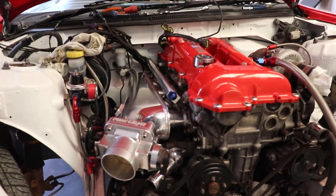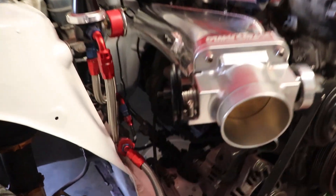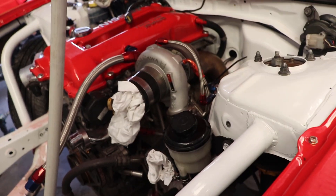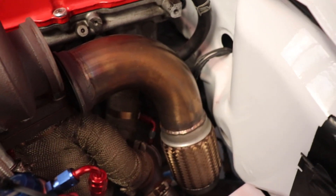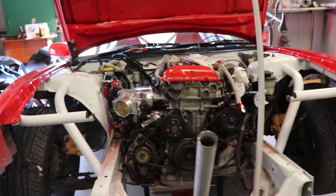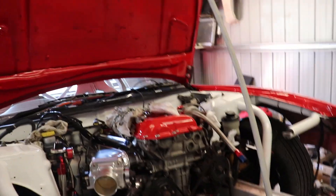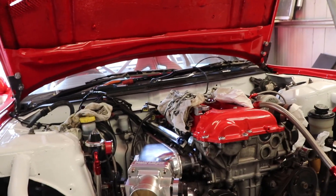We're getting there — fuel lines are off, wiring's been pulled out from under there. I've just got the engine mount, there's a slave cylinder on the gearbox, the gearbox cross member, the oil lines for the turbos, water lines I'm just going to be pulling out with the motor. Dumps are off. I've got the engine mounts undone, hooked the chains up to the motor so she's ready to pull. I'm going to slide the engine crane in, put a bit of tension on the chains, undo the gearbox cross member, and start to pull her out.